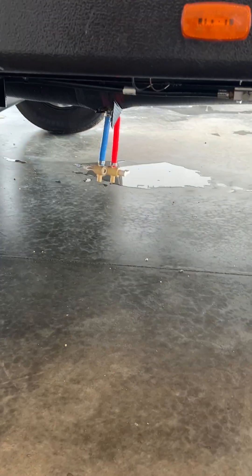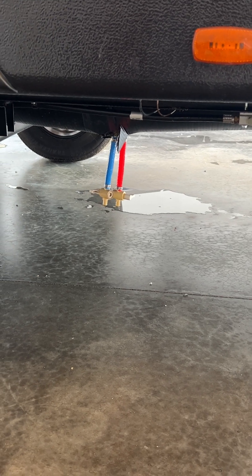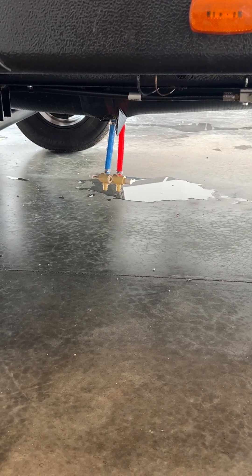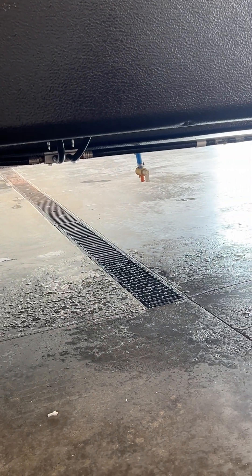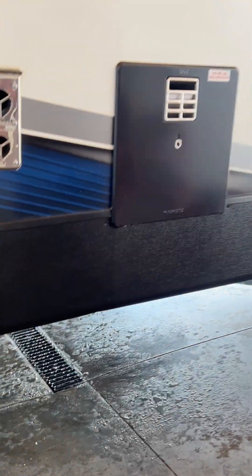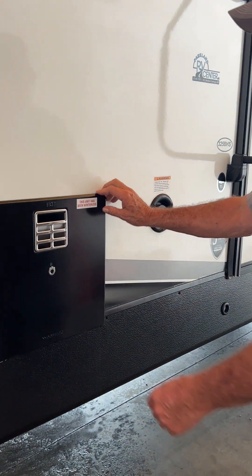While we're here, you have the two low water drain points — the blue side is the cold side of the water system and the red is the hot side. The blue line right about four feet in front of that is your fresh water drain for draining your fresh water tank. Fresh water tank fills here and drains underneath the trailer.